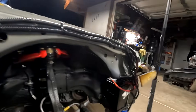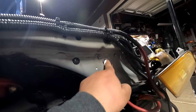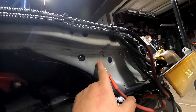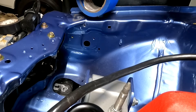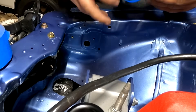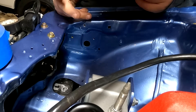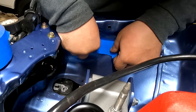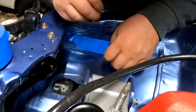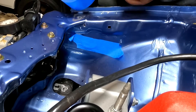Now we're going to move on to the charge post. I'll probably use this one for the positive and drill the one to the left for the negative. I'm okay with putting holes on this side of the frame because if I didn't like it I can always put a catch can there and you won't see it. If I did it on the firewall and then decided I wasn't going to use it, I'd have two holes there.